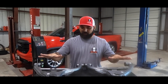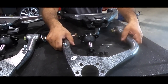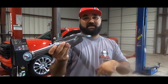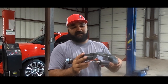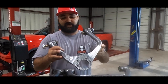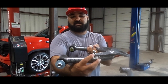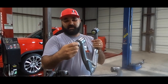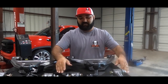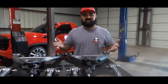For the upper control arms — it's a standard upper control arm to make sure your alignment gets dialed back to zero. These upper control arms have a built-in ball joint angle to make sure we're getting the correct suspension geometry, so although we're lowered it feels the same as stock. The ball joint has the right articulation so nothing's binding. It is a bolt-in ball joint. These upper control arms are directional — passenger and driver's side. We also built in a stud to hold your ABS brackets in place. For 2019 to 2022 trucks, we include new fine-thread hardware to make sure everything stays in place.